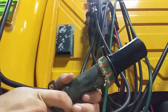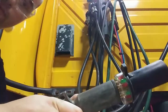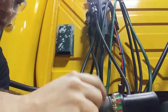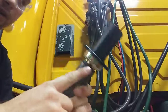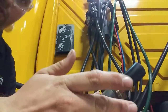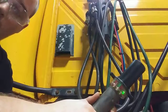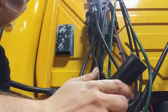And see, it does the exact same thing because all the electricity flows through this green cable, and this plugs into the trailer and it'll tell you. This one right here is the left turn signal and that one's the right. Since they're flashing green, that means they work just fine. If they were flashing red, they would need to be fixed or replaced, or whatever break in the line needs to be addressed.